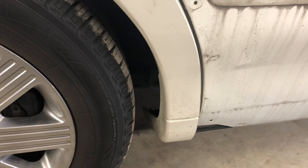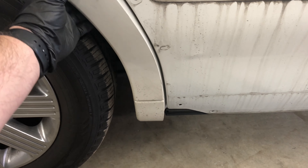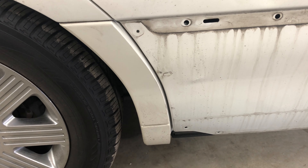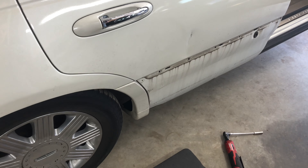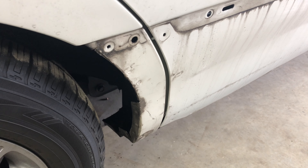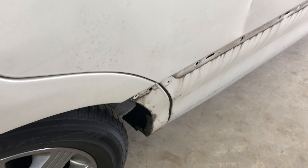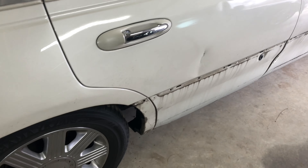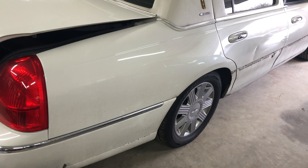The next thing I'm going to take off is a little quarter panel trim piece here. I figured there might be a dent right about there. Pulling that off, there's not much going on underneath — it looks like there might be a little bit of a dent but it's nothing major, nothing I'm really going to worry too much about. I do need to replace a couple of the clips on that trim piece. It was going to have to come off anyway in order to blend this quarter panel when we replace the door. I'm really disappointed to find out I've got to buy two doors, but it is what it is. I've also got to pull the taillight and the bumper, but we'll worry about that later once we get a little closer to paint.